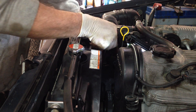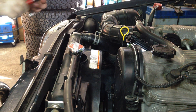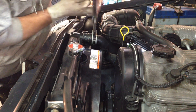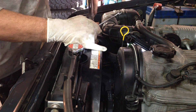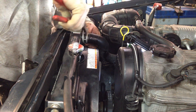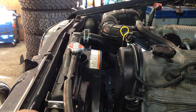Put the upper radiator hose back and fill up the cooling system with some new coolant. Don't forget to bleed it — there are a lot of videos on YouTube on how to bleed the cooling system. And that's it for this job. I hope you enjoyed the video and I'll see you on the next one.